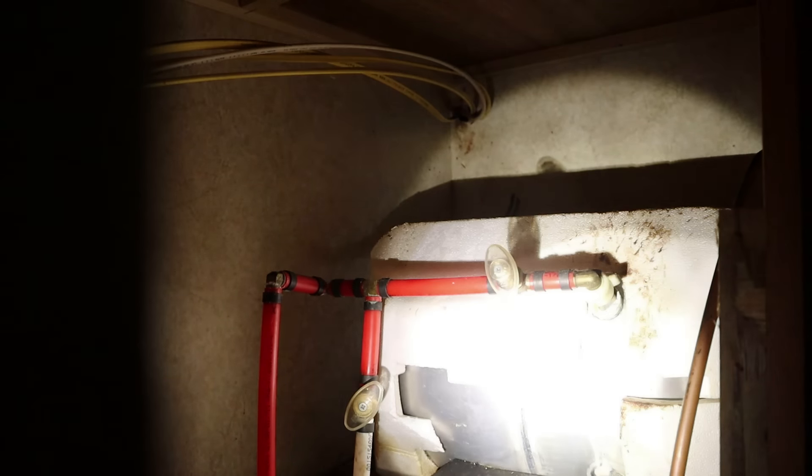I'm gonna get my meter out and start checking power. I'll have to put my head right in there so I won't be able to video it. There's a relay in there — it's actuated by 12 volt, which closes the relay and sends AC power to the heating element. I need to see if that's all working, or if the heating element is just burned out. I'll report back when I have more info.